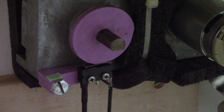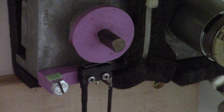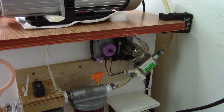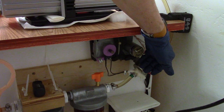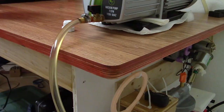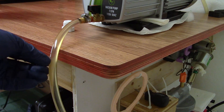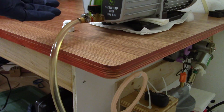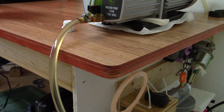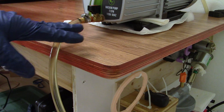If I weren't running the continuous oil filtering system, I would probably limit my batches to four, five, maybe six pounds maximum. When the oil is clean and new like this, the only way I can tell it's running — besides hearing it — is to touch the pump and feel it. Otherwise there's not much to see. When freeze drying is happening, you'll see cloudiness and water droplets coming through this hose. Without running the filter for even half an hour at a time, it really gets a lot of cloudiness. I can understand when people say they have to change it every batch — I can't imagine running without this. If I didn't have this, I think I would have to go with an oilless pump.